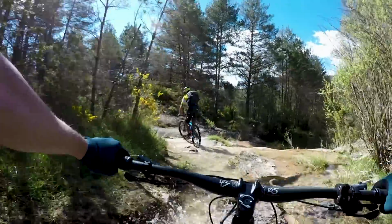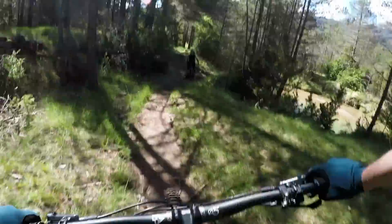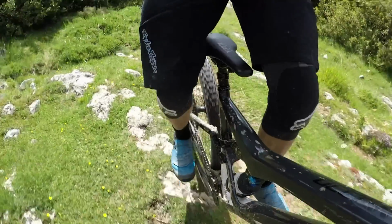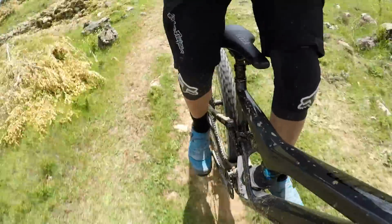Now, within this customization of the bike, they allow you to fit a 150mm fork, and this slackens the angles by half a degree. Rounding it out, you get 440mm chainstays across the range, and you get a 336mm bottom bracket height. In terms of suspension, Orbea have opted for a relatively regular 4-bar suspension design, which they call concentric